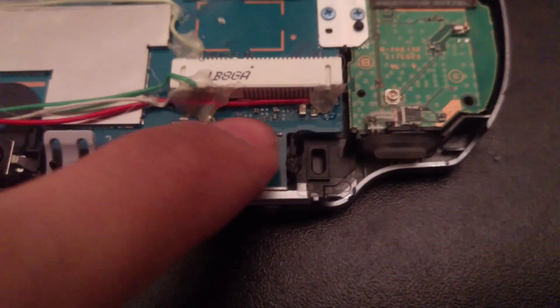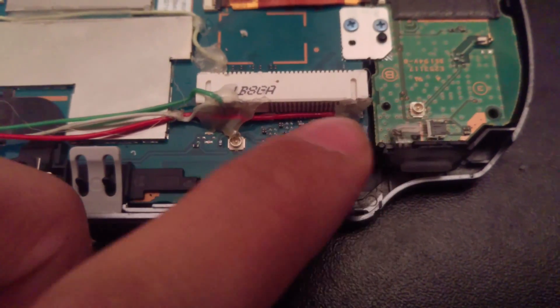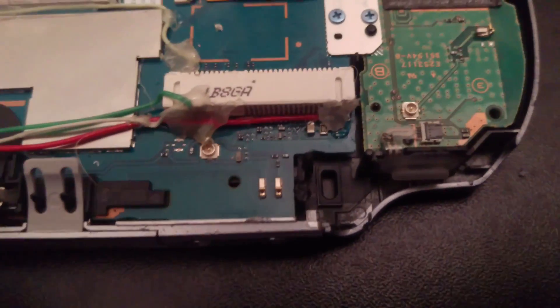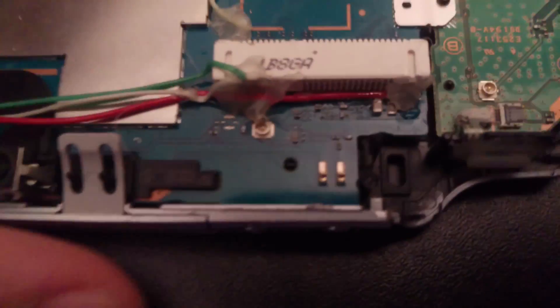As for the positive, since all of these pins are pretty much bridged, there are five volt ones. I just sent a wire through, have a wire soldered there, and the reason I use hot glue is these small pins can be very finicky. So I've basically secured them down. For the ground, I used a different ground pin because it would simply be easier for me, and I ran the wire through here and sealed it off with some hot glue so it doesn't move.